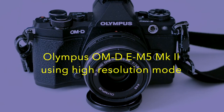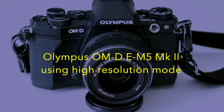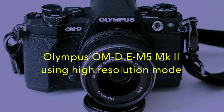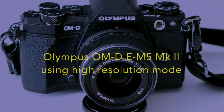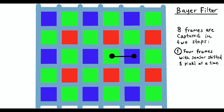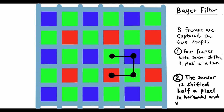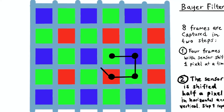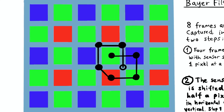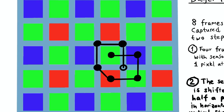The camera used in this video is a mirrorless Micro Four Thirds camera, Olympus OM-D EM5 Mark II. This model has a special feature called High Resolution Mode, which enables shots with up to 64 megapixel images using a 16 megapixel sensor. That is achieved by shifting the position of the sensor half a pixel in the vertical and horizontal direction in a special pattern, creating 8 images which are then merged into one 64 megapixel image.